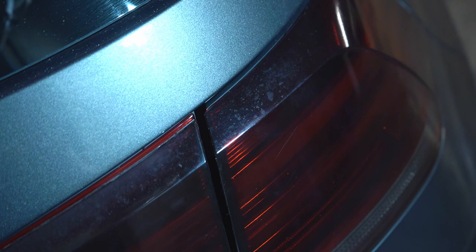So when I go through with a light polish at the very end to refine everything with Perfect Finish, I'll probably hit them real quick just to bring back a little bit of gloss. A lot of people might know, but when it comes to vinyl wrap and PPF and even in some cases tint like that, you can polish it very lightly. You usually never want to, but in this situation, I'm going to hit it real quick with some Perfect Finish at the end of everything before we coat it. And then that should take care of it for now. But yeah, it's pretty rough. Not good.